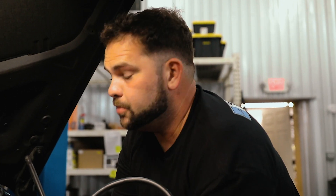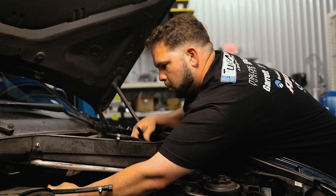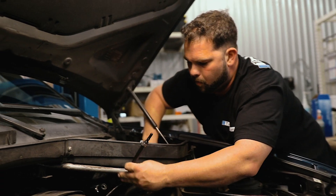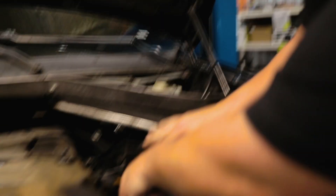For the best fitment, take the female end and install it in the rear hole, and take the male end and put it in the front hole. Grab an absorbent pad and drop it down there. One important thing to do before starting this project: take the keys and lock the car. If you don't lock it, the low-pressure fuel pump might randomly kick on and shoot fuel everywhere.